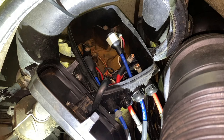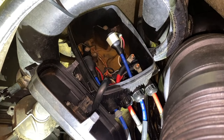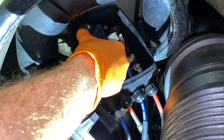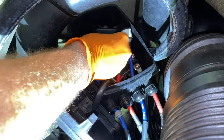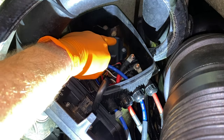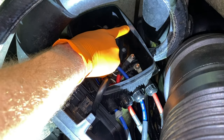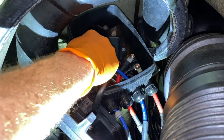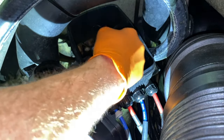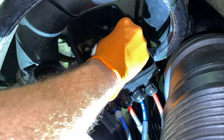Back to the jet ski, inside the hull at the electrical box. The bottom ignition coil is the one without white electrical tape. This might be the trickiest portion of the project — aligning the screw holes at the bottom. It's important to note that they are offset: one screw hole is at roughly the halfway point of the electrical box while the left-hand side is further back toward the rear, so the coils sit slightly offset inside the box.